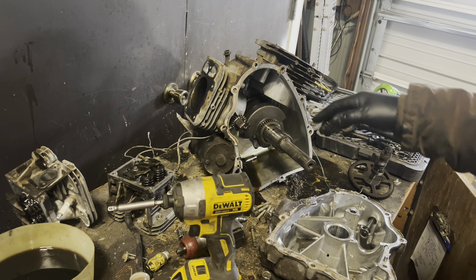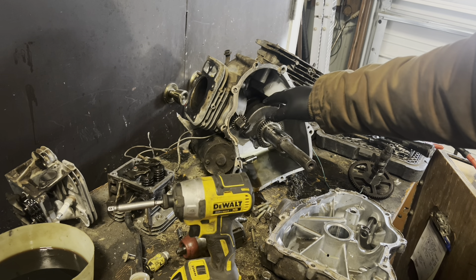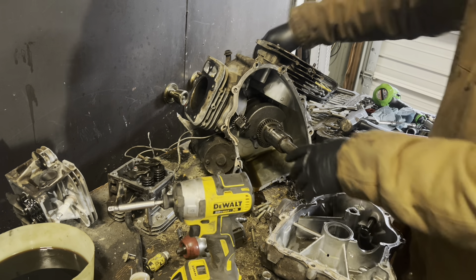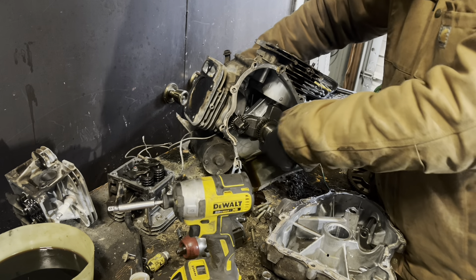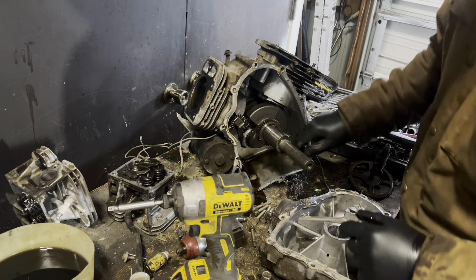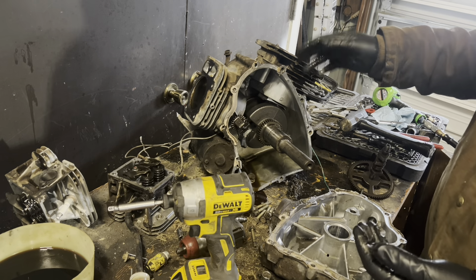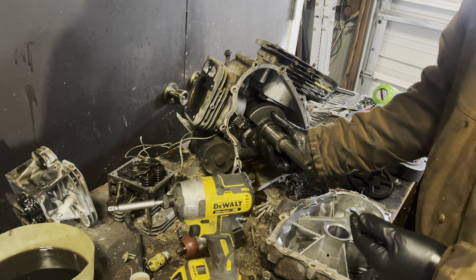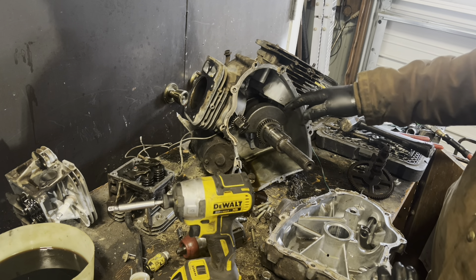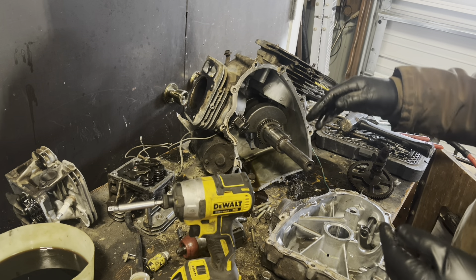This is a vertical shaft engine. By putting oil all the way up there, you're putting oil at the top of the engine where it can sling all around for adequate lubrication. When you don't have that kind of lubrication, you run the risk of your crank journal and your cam journal running dry — and that is what causes engines to explode.